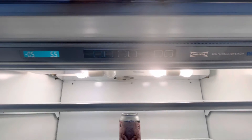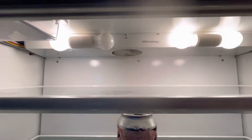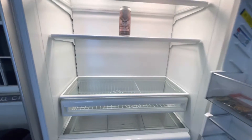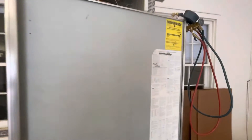The next thing I want to look at are these two switches up here. One is your light switch — it seems very responsive and working. The next is your evaporator fan, which is also working. I can sort of hear gas going through the tubes and I don't see any frost back there, so that's good. That kind of tells me that the compressor is working.